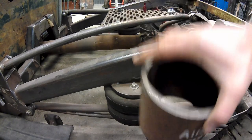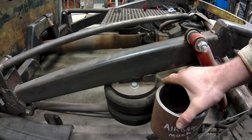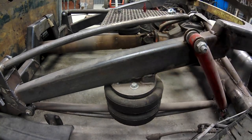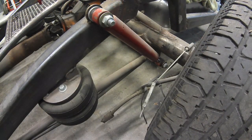So when I designed this, I took this piece of pipe here and tack welded my upper and lower bag plates to it, welded the bag plates in, cut the tacks out, pulled it out, and that gave me perfectly aligned upper and lower bag plates.